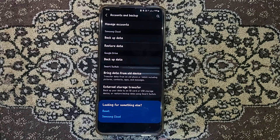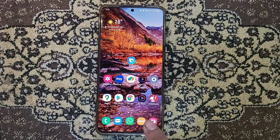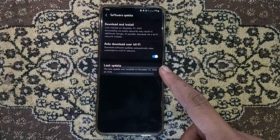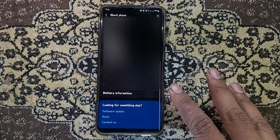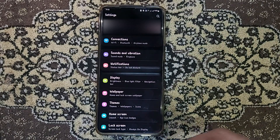So, a factory reset will be done. Some people who are using UPI might not be able to use Samsung Pay, because in Samsung Pay there is no UPI option if you switch to this CSC. Your warranty will not be void — I confirmed this when I went to a Samsung showroom. Regarding updates, I received the last official update recently on the 23rd, on the same official ROM. So no need to worry about updates after the reset. The only thing Samsung has locked is eSIM for Indian models, and I will show you how to enable it.